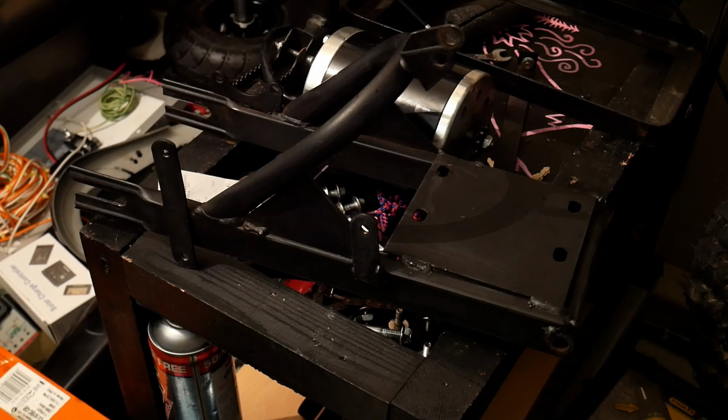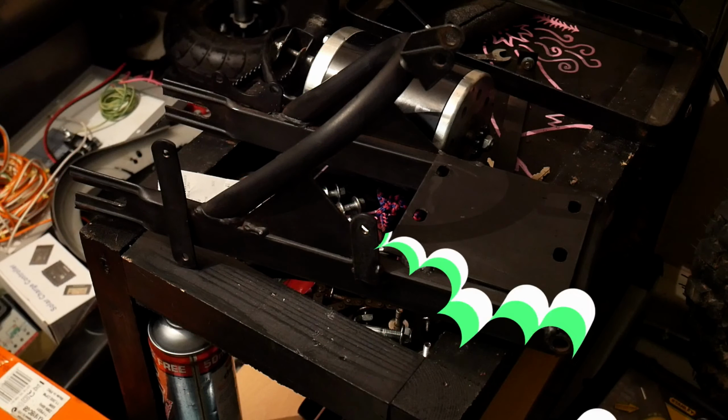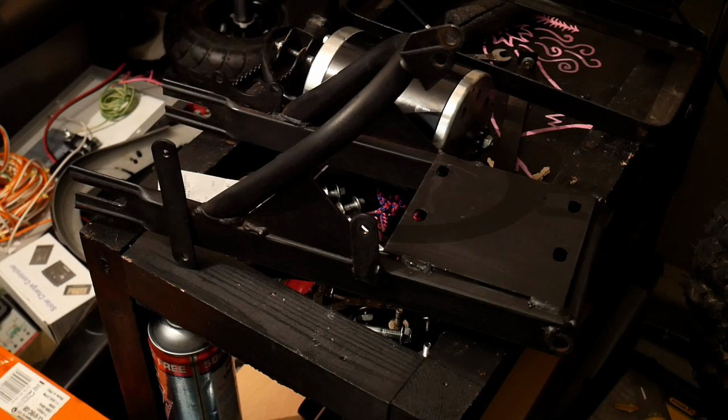Right, I've sanded the swing arm. I've also degreased it again. I got the citrus degreaser in a little dish with a toothbrush and scrubbed it all. You don't want any grease on when you spray it, you'll get orange peel. Now it's 7:52 and I think I'm going to get it on my balcony and spray it.